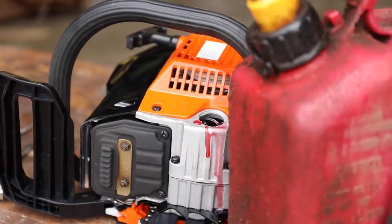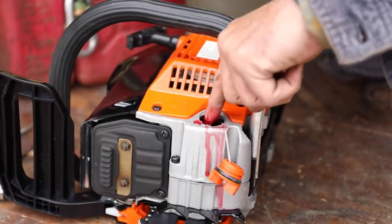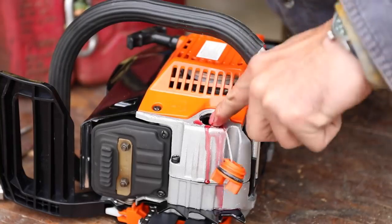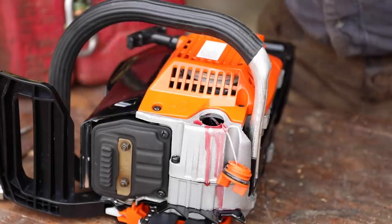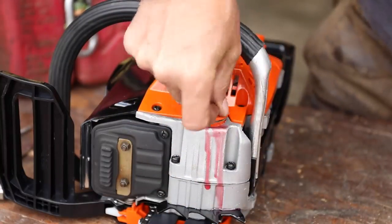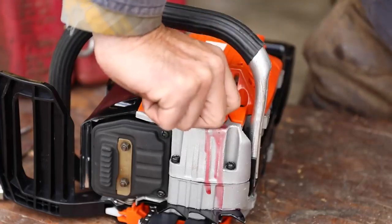Problem with that is the stickiness of oil. So if you take bar oil, for example, like this, look how stringy it is. See how stringy and sticky it is there? Well, that's required or recommended so that it sticks onto the bar, so it's not all flung off the end, and that it sticks and hangs out on the bar.